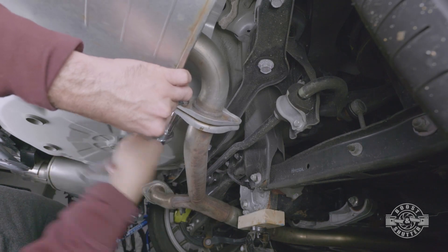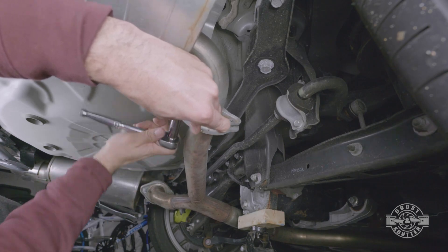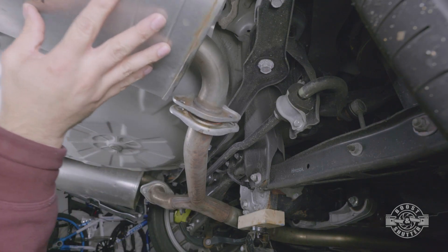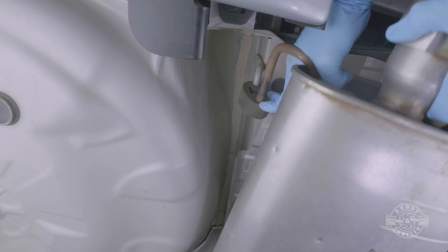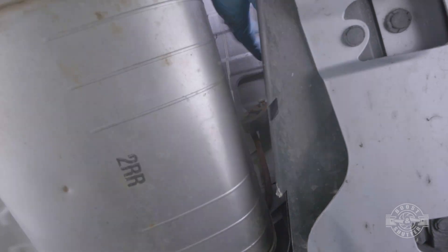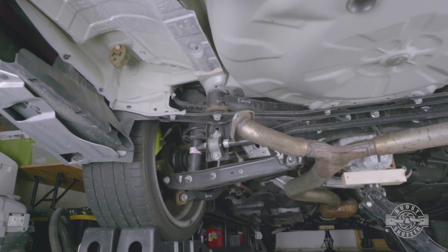If you have an older car it may help to use some penetrating catalyst to help get stubborn bolts out. I didn't have much trouble using a small ratchet as you can see, but a breaker bar might be necessary. With the bolts removed the muffler is just gonna dangle there. It's held in place by one exhaust hanger on each side like you see here. These are not usually difficult to get out. I start on the inner one and just wiggle the muffler back while pushing the hanger in the opposite direction. Just remember to support the muffler so it doesn't fall on you. On the outer one there's a little bit less room but the process is the same. If it's really difficult you can use some WD-40 for lubrication, and that right there was the right muffler, but the left muffler is exactly the same.